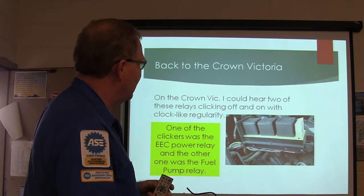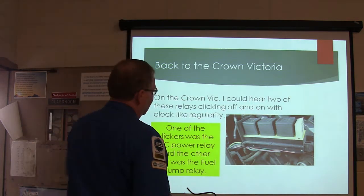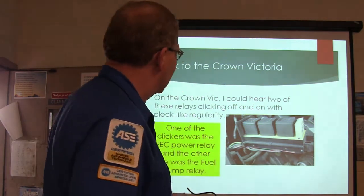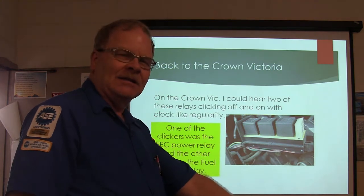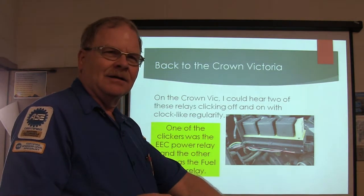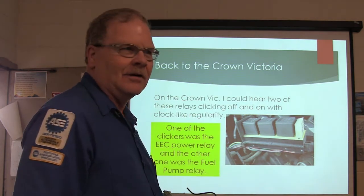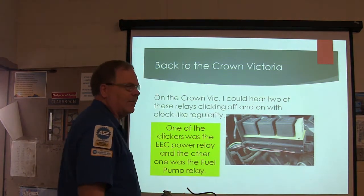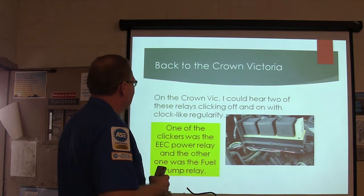Well, on this Crown Vicky, I could hear 2 of these relays, and you recognize those relays. You guys have seen those before, haven't you? I heard 2 of those relays just clicking off and on. Put my hand on them, it said click, click, click, click, click. Like, what's turning those relays off and on? What's up with that? So one of them was a power relay, and the other was a fuel pump relay. And they were both clicking together.